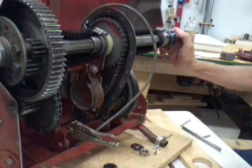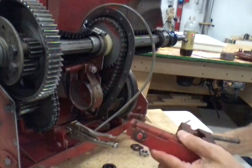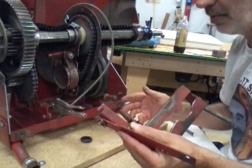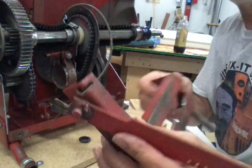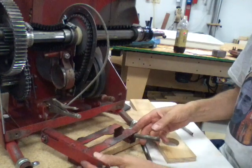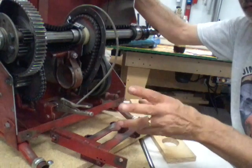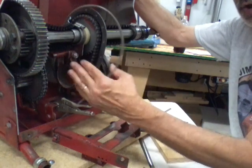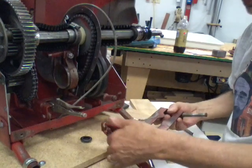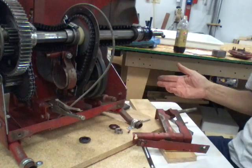Your clutch cable will come down — this is another yoke and it fits in here like this. The end of the clutch cable has the same part on it as the brake cable does: it goes in this hole, tips up, gets caught in there, and you run it through the tube along with the brake cable and hook it to your pedals. That's if you have two pedals. If you only have one pedal, you won't have this cable or this brake — the only cable you'll have hooks to this, and when it tips up the yoke and you keep going, it'll apply the brake and lock it up. That's about all there is to it.